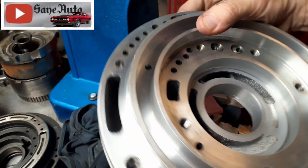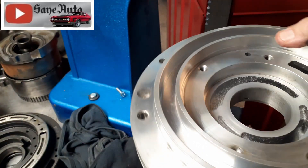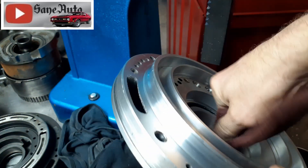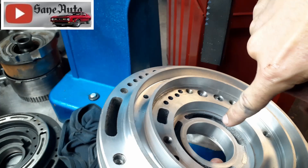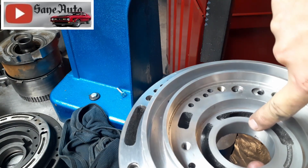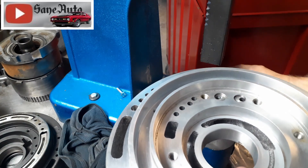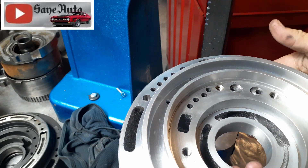Now you can really see if any of those scratches were deep. That's about it — we can just give a little bit more extra work on that spot. The scratches themselves are not a problem in isolation; but if you look at a scratch with a magnifying glass, either side of each scratch has a raised edge that sticks up above the surface, and that raised edge would sit between the pump body and the bushing, pushing the bushing toward the hub.